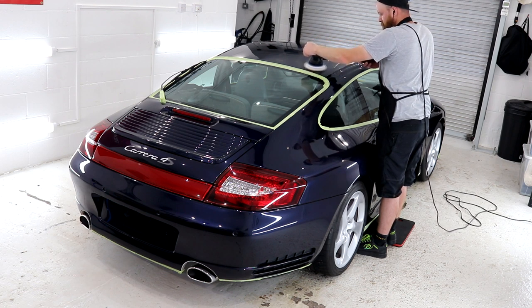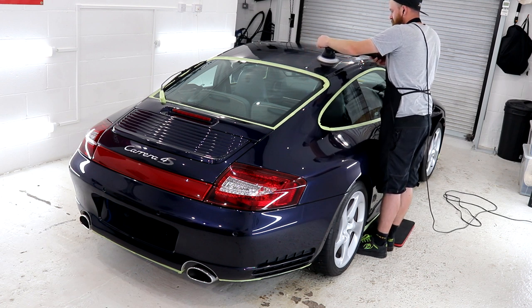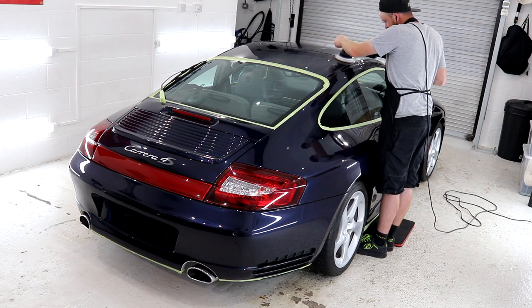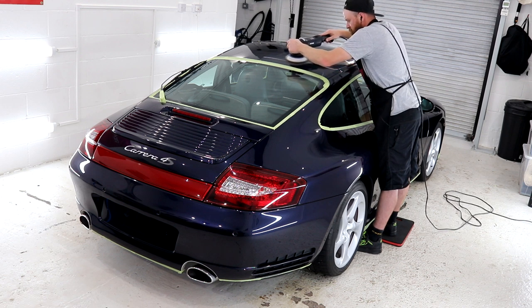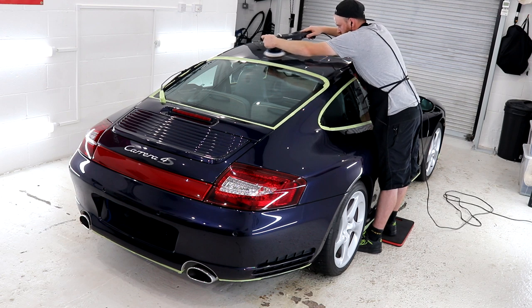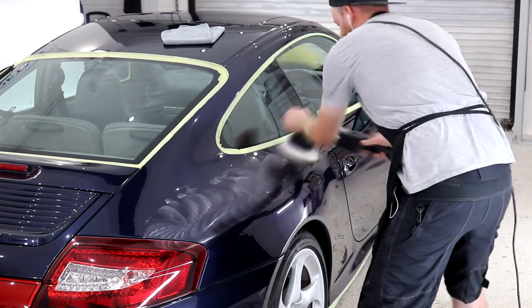This does depend on how much polish you are applying to the pad, but generally by doing the crosshatch pattern twice, i.e. twice vertical and twice horizontal, whilst maintaining a slow arm speed, is going to give the polish enough time to work on the surface. Areas where a crosshatch pattern just isn't possible, then I quite simply just make sure that each area is covered with a slow enough arm speed and enough passes. This is one of the difficult things to try and explain, and one that does become second nature with a bit of experience.